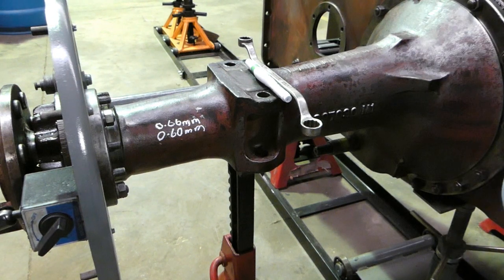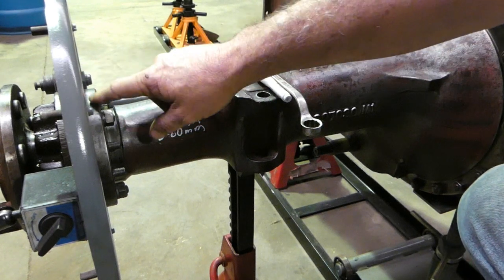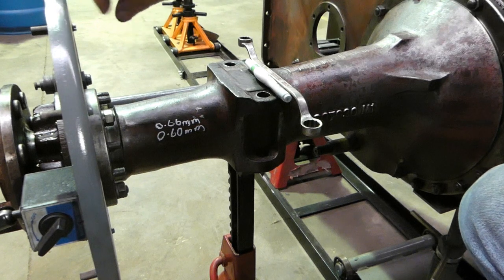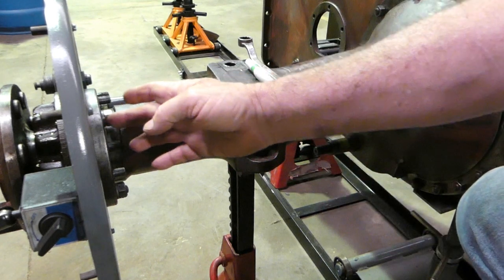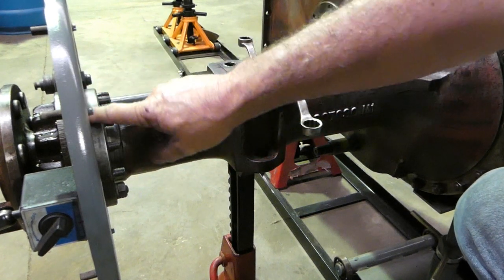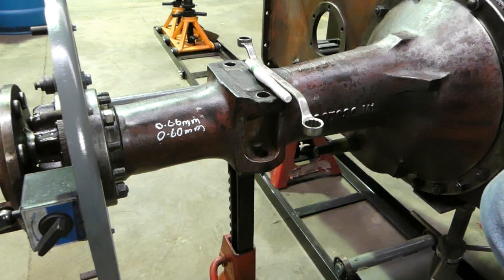So when you look at the parts manual, it also shows that all the shims are between the brake backing plate and the axle flange here. There's none on the other side, which I suppose would keep the brake shoe and the drum and all in line with the end of the axle nice and evenly. So the adjustment would be made as the whole unit comes out. So look, we'll pop this side off, we'll replace this shim, and we'll come back then.